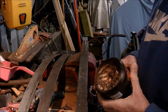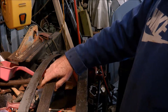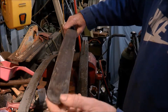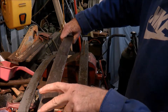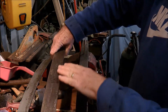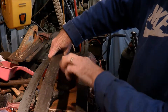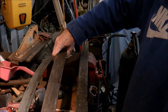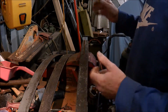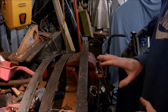I'm going to use some copper grease — not over the whole surface, but when you pull these apart you can see around the ends of the springs, around the area where the other one overlaps, where it actually wears. When you picture the way these work, they flex up and down, so most of the movement will be on the end of the leaf. I'll mainly put a thin layer of copper grease on there and gradually assemble them — put a new bolt in the centre, leaf by leaf, and at some stage I'll probably have to cramp it down.